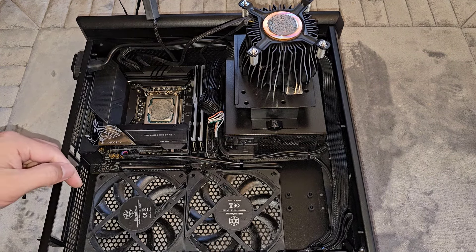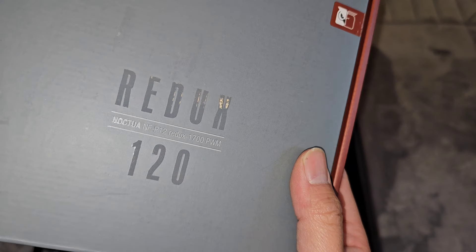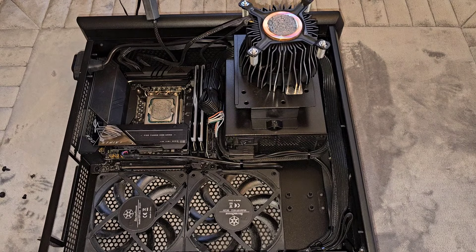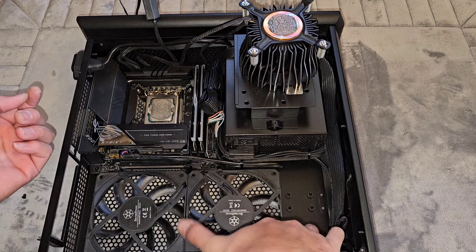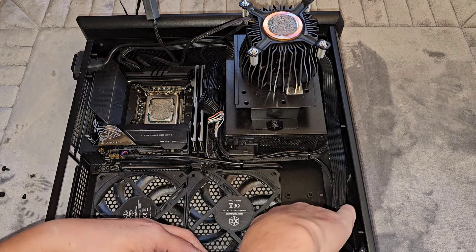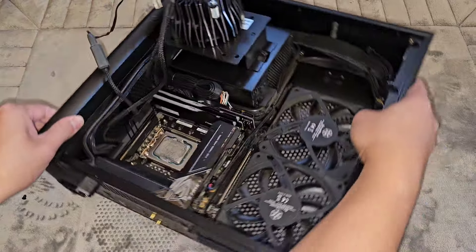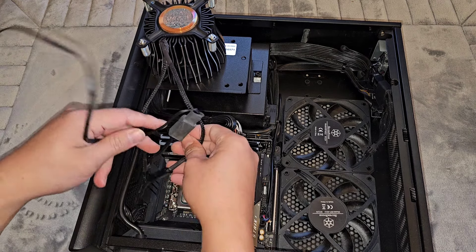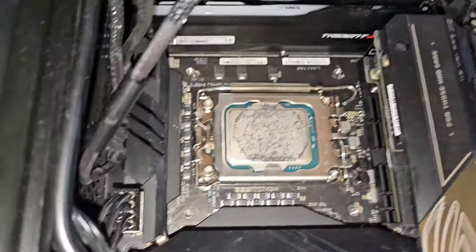I need to clean the bottom of the GPU now that I can. It looks like I can fit thicker fans here, so I'm going to replace those. We got these Noctua NF-P12 redux 120mm fans — much faster spinning at 1700 RPM. The reason we got those is because the customer was saying it was locking up or freezing, so I'm hoping the faster more powerful fans will keep it cooler and prevent issues. Let me pull the CPU cooler out because it's in my way.